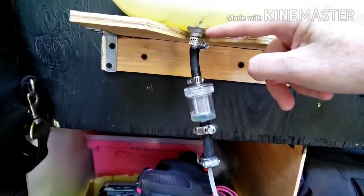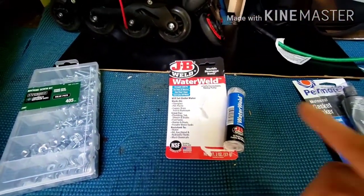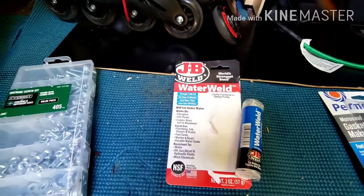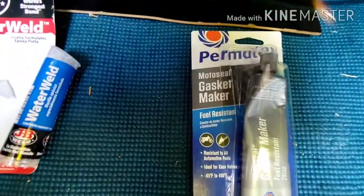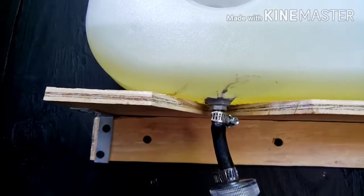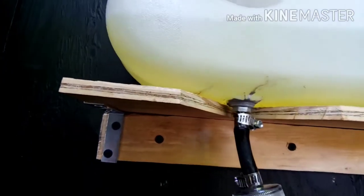But then I think where it was leaking was actually where the plastic meets that little o-ring there. The tricky thing is you need something that can handle diesel fuel — the first sealant we tried wouldn't stick to the plastic tank, so that didn't work. Then I went and got this gasket maker, which is rated for fuel. You can see that gray stuff there — it needs to cure for 24 hours, so we had to dump out the diesel fuel, take the tank down, and wait a day. But it's working now, so that's good.